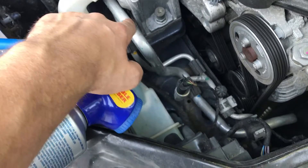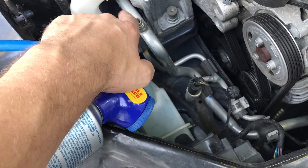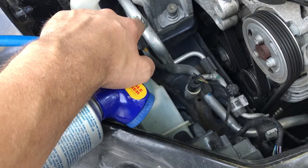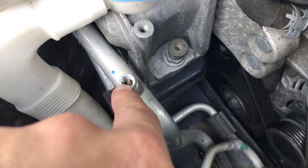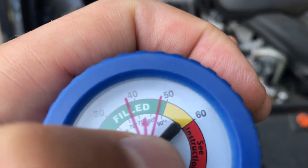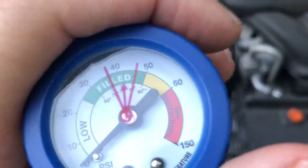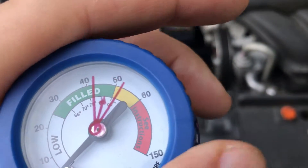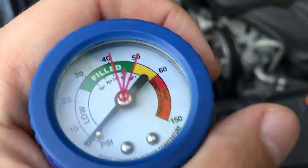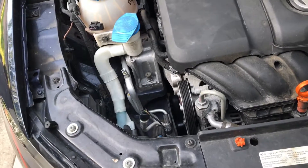Another issue is that you may have overfilled your AC. Just take a needle, like a bike tire valve — cover your eyes — and push that needle in to lower the pressure so your PSI is in the green, upper green, around 45 to 50. Don't worry about over-adjusting; people want to make this a science, but it's not — this is the easiest thing you can do to your vehicle.